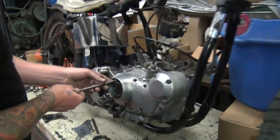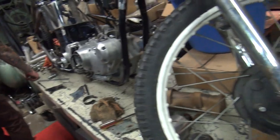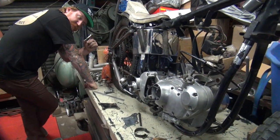What are you doing there? Are you assembling an ignition module? Did you time it? Yep. It's going to be perfect. Perfectly timed? Mm-hmm. All right. Motor mount bolts. Yep. About 2 1/4 inches long, 3/8 fine thread. That? Could be.